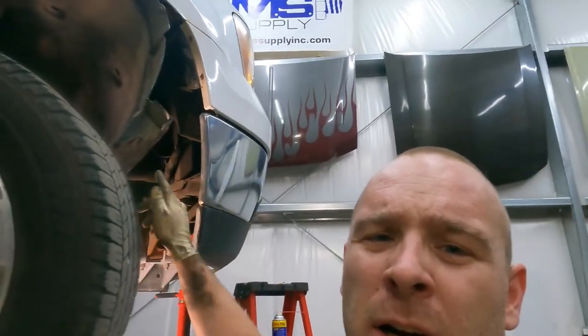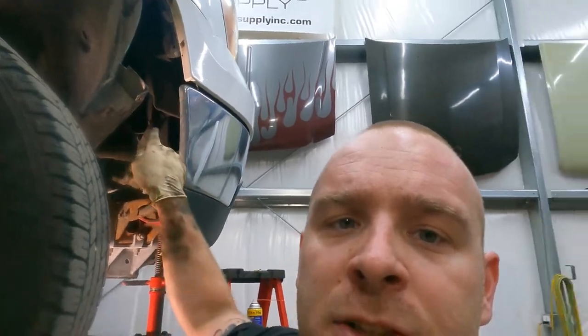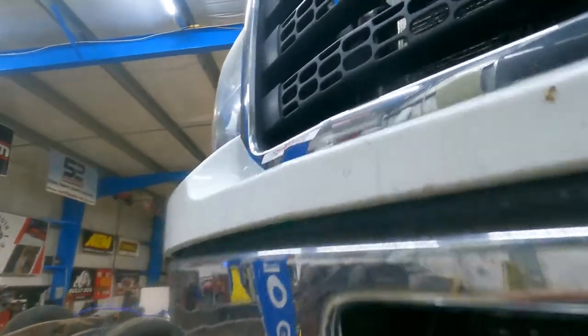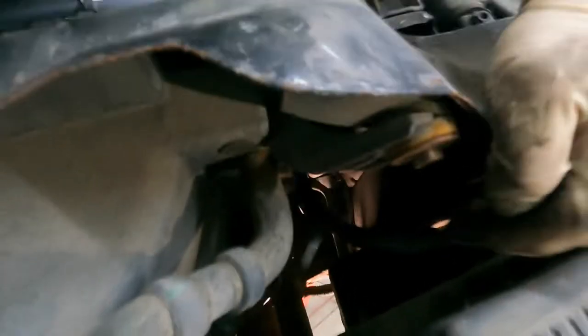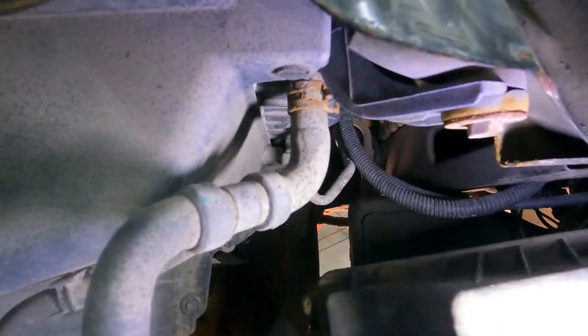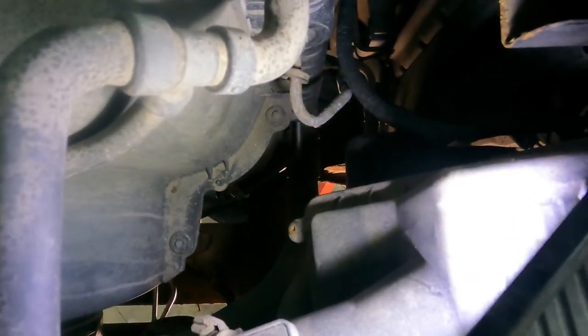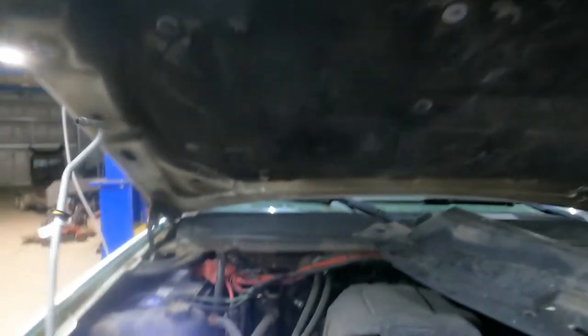That one went in real easy — it's right here in front of the front tire. I turned the front tire, pulled a couple of clips out of the inner fender well, and you can reach right through up in here to get to it. There's one more line left. It goes from the passenger side of the cooler, comes down like this, and goes up. I took off the shroud here to give a better visual. You can see the one with the hard 90 right there — that goes into the top of the rad. We'll pull that little black clip backward just like all the others, and it goes in.